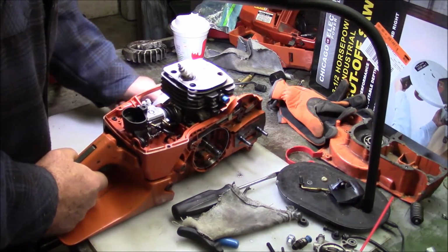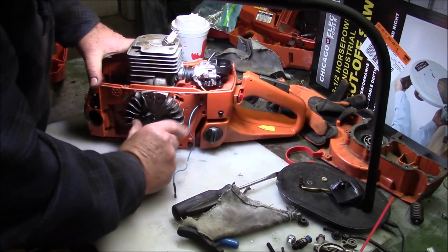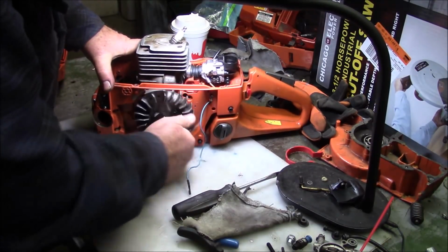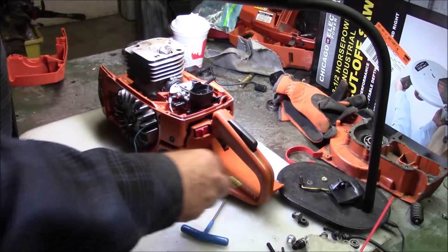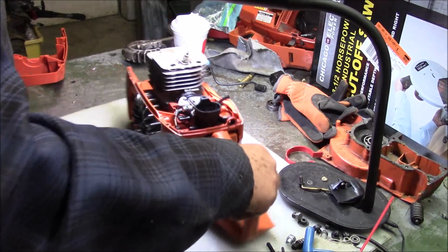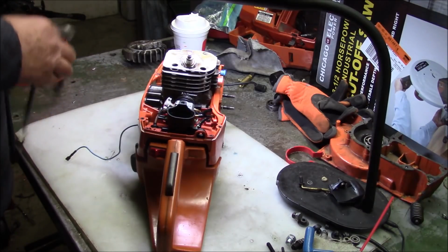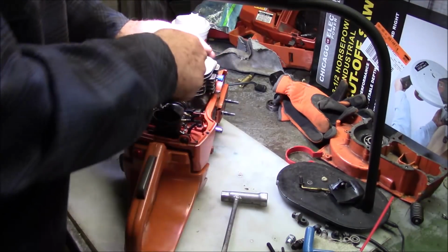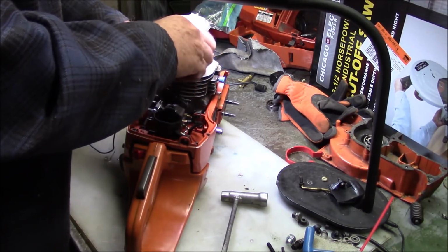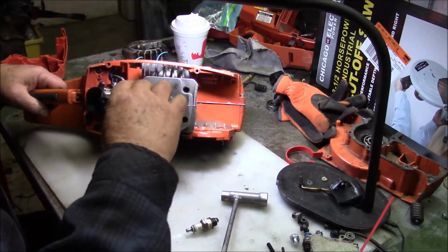Oh yeah, I can tell you right now. Yeah, that has got some serious compression. The measure of success in this video is if I can pull that plug and measure squish and have it be somewhere close to what I was shooting for, which was around 20 thousandths, right? Still have the pop-up. And remember, we just sort of shot in the dark with this. But I guess before I do that, I better crank the cylinder down.